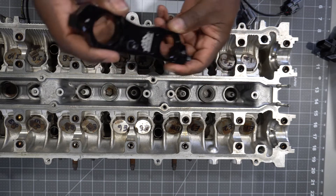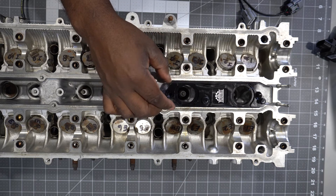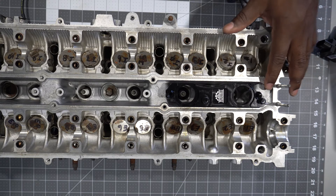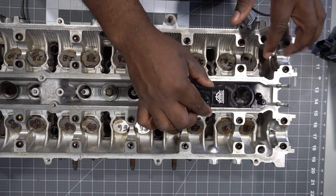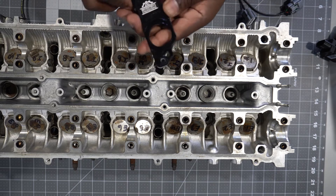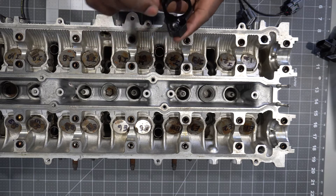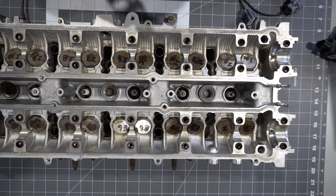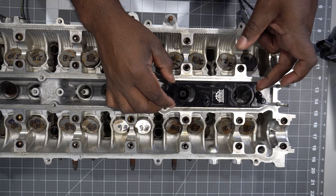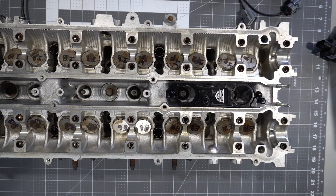This angled end points forward, and you can also use the orientation of the logo — the logo should be readable from the front of the car. The reason for this unique orientation is that on VVTi-only front-mount posts, you will have to notch a little bit of the lower corner because the VVTi cover protrudes very close to the edge. That modification wasn't something I wanted to chance in the machining design, so for VVTi guys you will require that slight mod. Non-VVTi guys do not have to touch it at all.